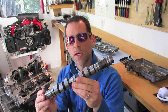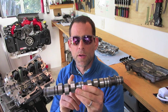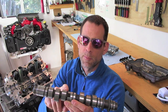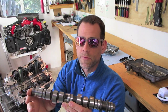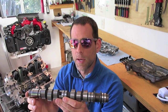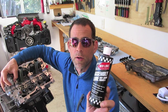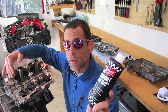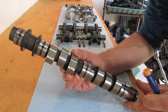One of the first things you're going to do when installing one of these camshafts is lube up the journal bearings. In this video we're going to lube up the cam journals — there are actually four of them — and we'll lube up the four journal surfaces in the cylinder head as well. Use some kind of assembly lube or 30-weight oil; I like to use Redline assembly lube, it's worked really well. Lube up the journal surfaces both in the cylinder head and on the camshaft, and then we'll drop the camshaft into the head.